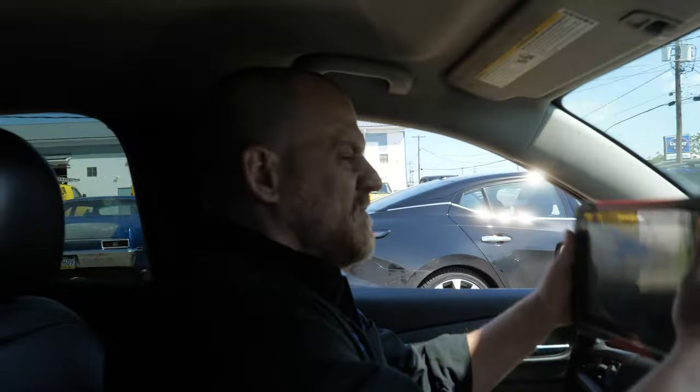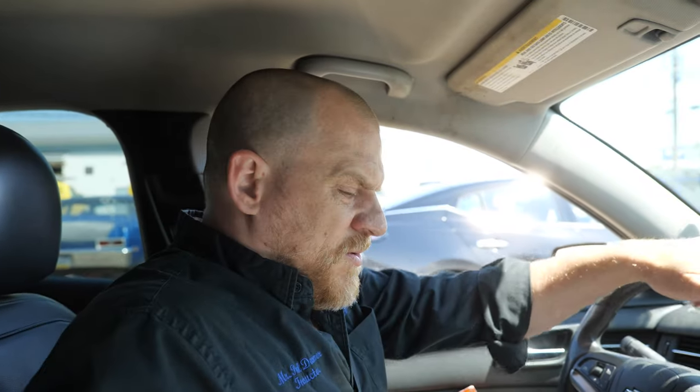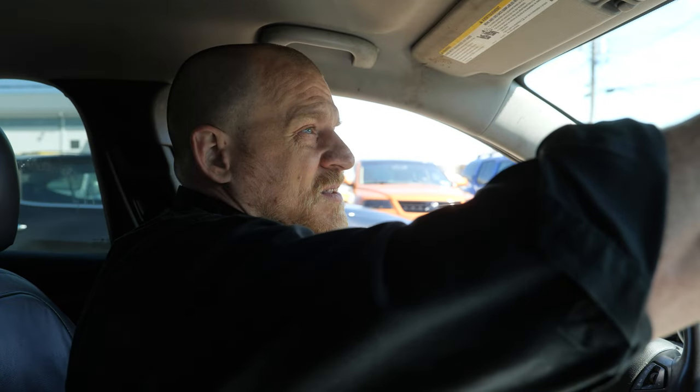Yeah. It is possible that by loosening and tightening that ground, he may have fixed the problem that I'm suspecting he had. The main problem, which is this O2 bias being too high, fooling the computer into thinking it's really rich and taking all the fuel away, and that was causing the stalling.